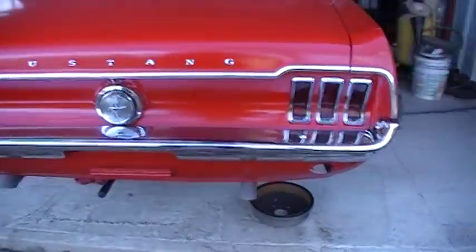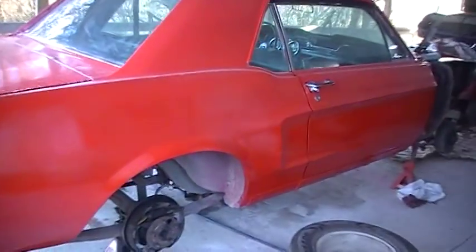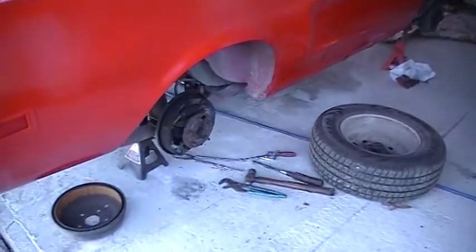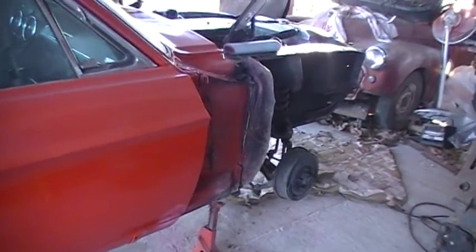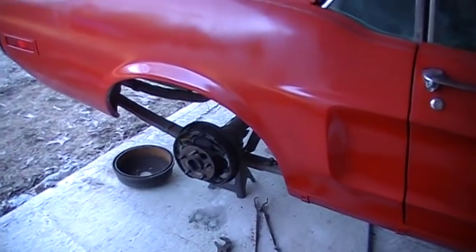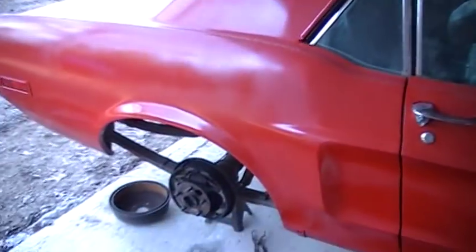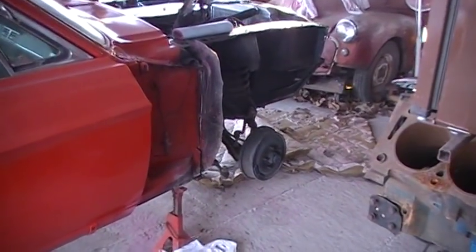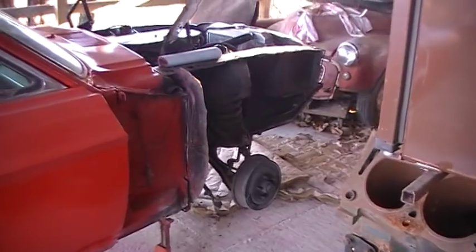Give me your thoughts on that and don't be shy — why they had that stuff adjusted all the way up. I checked the star adjusters down there and they're marked for right and left side; you take that little cap off the end and they've got an L or an R on the adjuster. Anyway, let me know if you think that might cause it to have a full pedal and no brakes, and why they did that. I can't find any problem with any of it unless it's a master cylinder maybe bypassing.